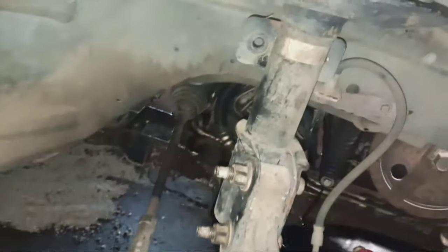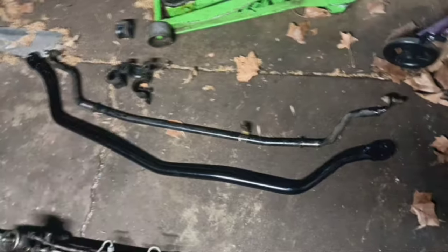That was a pain in the ass, but David helped me get the original sway bar out. I'm upgrading to the other style — see how much beefier this thing is. This original one weighs nothing, the new one weighs like 25-30 pounds. Nice and beefy with the poly bushings. Now I've got to try to snake this one back through there and get it lined up. I might have to end up swapping out the outer tie rods because these are pretty beat and busted up.